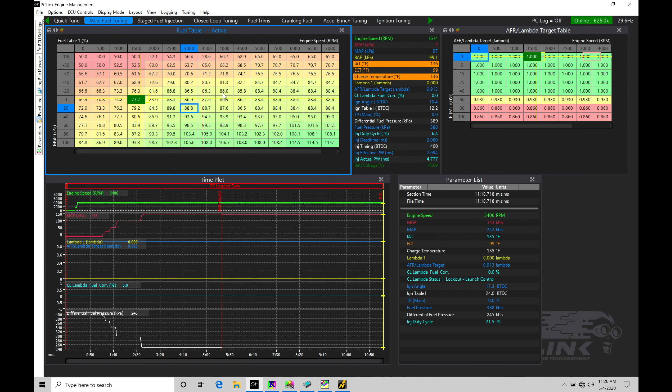My order of operations when working with water meth injection is to always go into my fuel and spark timing tables without the water meth spraying first, to establish a baseline. Then from there, we turn on the water meth and start to tune with it. When the water meth is going to be on, we need to implement our 4D and 5D tables to offset our main fuel and spark timing tables. There will be an arming switch into our LINK, which is typically the same arming switch going into our water meth kit to allow it to start to spray.